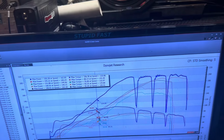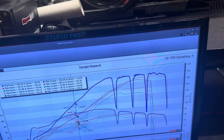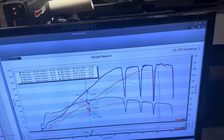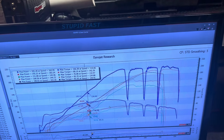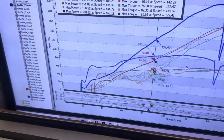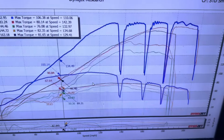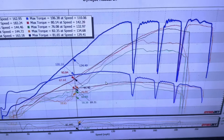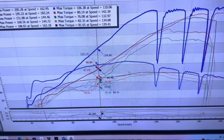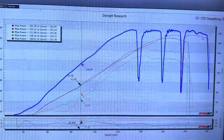where they put a restrictor, built it into the stack. It's not the length of the stack that's wrong. It is the restrictor that's built into it, to only lose in this one spot here, but gain everywhere else. I'll take that any day. That bike's going to be fast as hell. Look forward to hearing back from the client after he's done riding it home.